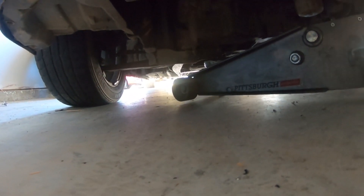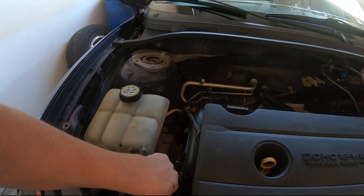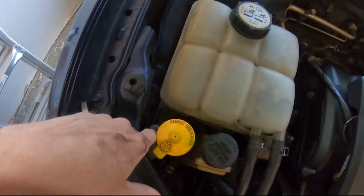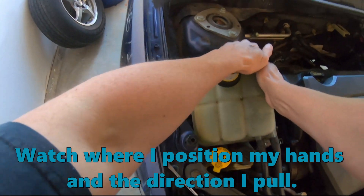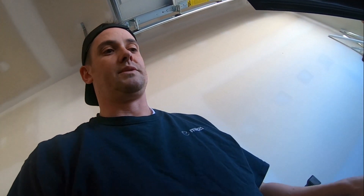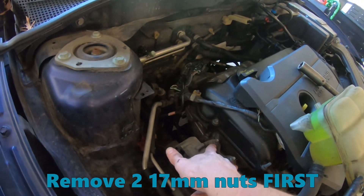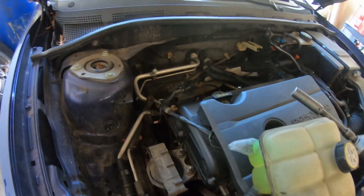We're going to jack up our engine slightly. Now with the engine supported, we're going to remove the coolant reservoir in order to get better access to the mount. If you look at the coolant reservoir itself, we don't have to take any hoses or anything off. There's a small push retainer here and a small push retainer there, and in order to get it off you just have to pull up on it. The order in which we do things can get kind of tricky, so pay close attention. With the coolant reservoir out of the way, I'm going to loosen these two 17 millimeter nuts first. It's pretty important that you do these first and then the mount ones later. I'll tell you why in a second, but you definitely want to loosen these two first.